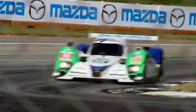They have an awful lot of aerodynamic downforce on them, which has to be controlled to the ground. If you don't have your aerodynamics correct, nothing else is going to work. So that's the first thing we do — we get our ride heights correct so that we don't hit the ground too hard.